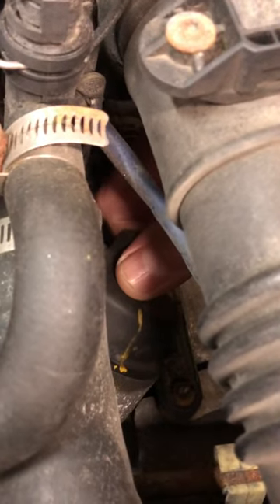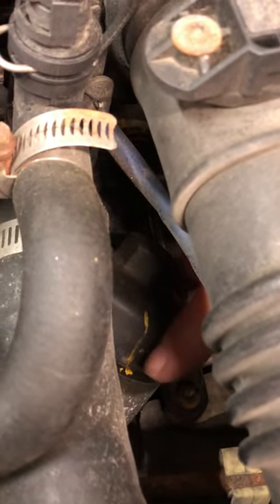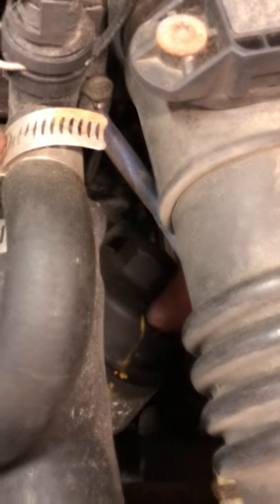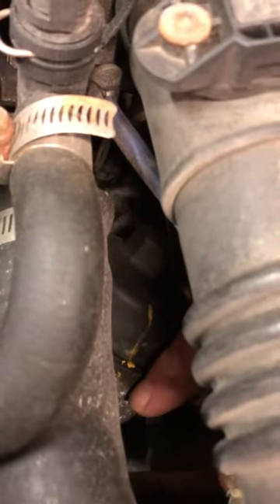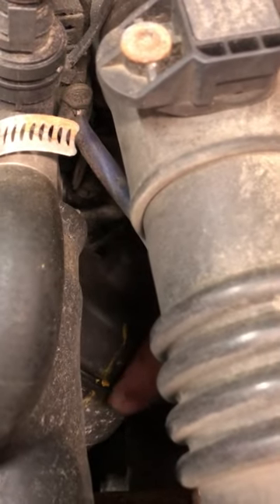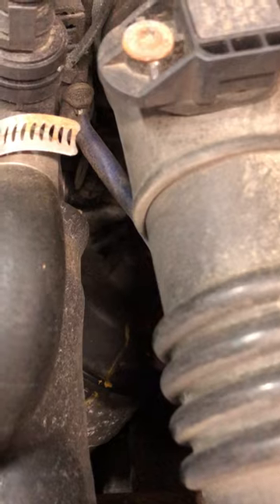This has the cartridge type filter, right here. You've got to take the cover off and put the new cartridge in it. What I like to do is, before I start the job, I take a little marker and put a yellow line on it and mark it up with the filter housing so I know how tight to make it — sort of like a little index mark. That way you don't need to bring out a torque wrench to do the job.